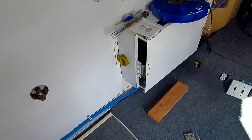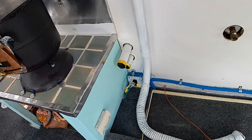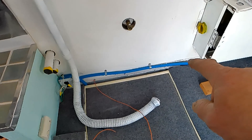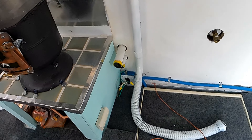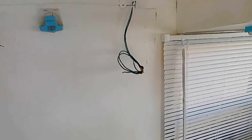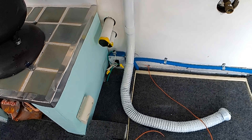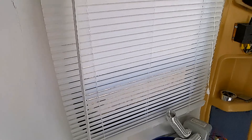When I took all this stuff out, I cut the wires free, cut them shorter, and put them on this flexible conduit here. I found a couple of them did not have any power. When I looked at the wiring diagram, I understood why — there's a big black wire, a number eight wire, coming from the battery, and that has to connect onto the blue wire and I think the purple wire to give them power up here. So I opened the box up and connected those wires onto it. That was my theory anyway.